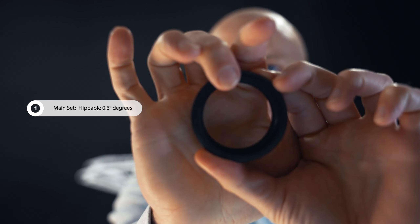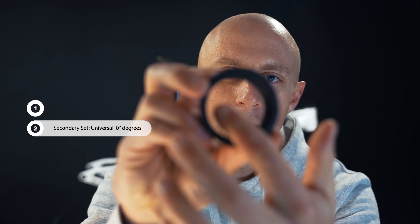First of all, there are two types of cups. One has a notch in the center while the other is unified without any notches at all. In addition, there are two pins which direct how the headset cup goes into the frame. That's the main thing you need to know, plus two other important details.